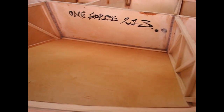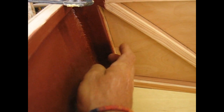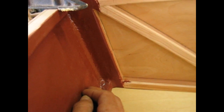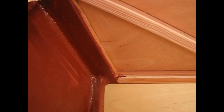Oh, God. So here's my leopard. Put the bottom on. But what we're going to do is continue the adhesion test. So, like I said in the previous video, this has been epoxied and filleted on, everything over here, this side wall. And then immediately I painted with my epoxy primer for steel on top of the flush epoxy while it was still wet. So now, it's 2 days already and this stuff is there. It's totally there. So let's just go extreme.